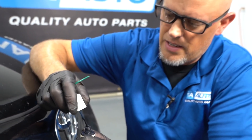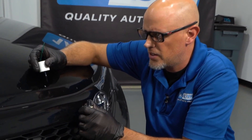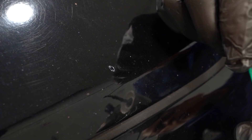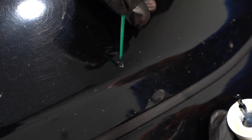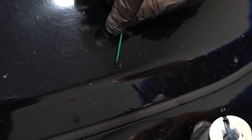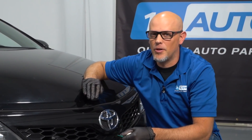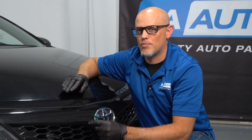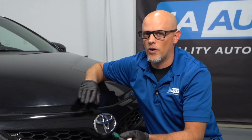Then take the paint. Sometimes the brush that comes with the touch-up paint is a little bit hard to use — you can try to dab it in there. But sometimes it's easier to just use a toothpick. You can spread it around a little bit. It might be raised up above the paint a little bit, which is okay. That looks pretty good. At this point, you want to let that dry before you do anything crazy. You don't want to drive the vehicle around or wash it, or hopefully it's not raining out — you want to have it covered up at least.